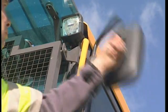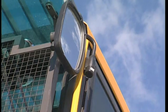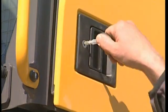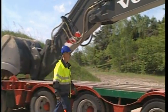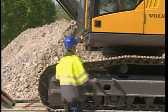Fold in all the mirrors and any accessories that are likely to increase the transport width. Disconnect the main switch. Lock all the doors and hatches because the high turbulence could cause them to fly open and result in damage. After a final walk around to check that everything looks normal, the transport is ready to leave.